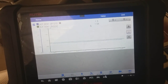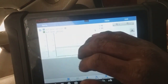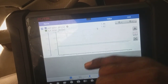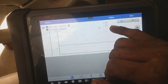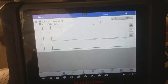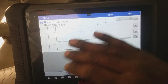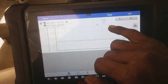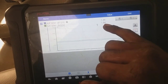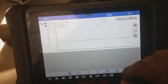And I guess from experience, if it misfires under load, then it clears up under higher RPM, there's some issue with arcing. This was just personal experience, general knowledge and experience of dealing with this. So I was able to make a determination based off of past experience. I pulled the coils because I had to do the valve covers anyway, and after visually inspecting those coil packs, the number 4 cylinder had that discrepancy.